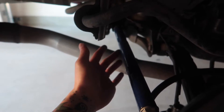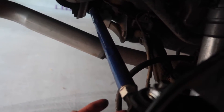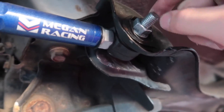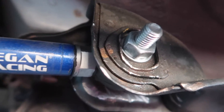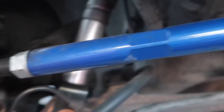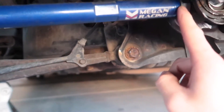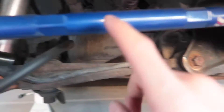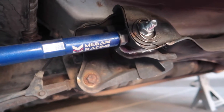If you install it the standard way, you're going to need your adjustable toe arms because it throws your toe off way bad. You can find this on eBay or Summit Racing, pretty much any performance shop online — just type in Megan Racing toe arm Prelude and I'll leave the part number on screen. Here was the OEM adjustment toe screw, which for me was just super frozen, so I had to cut it out along with the toe arm and bolt. I used some hardware from Home Depot — got a bolt and a washer. I installed these incorrectly where I threaded it all the way and left it open, which is a no-no because the only way to adjust correctly was to take the whole assembly out. Now I'm going to take it out and do it the right way.